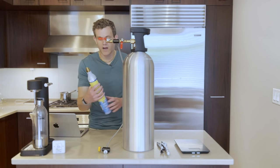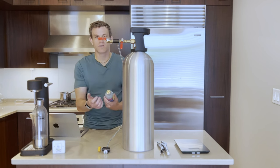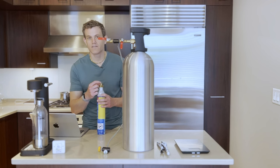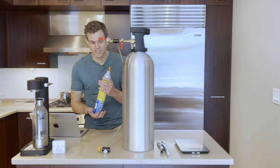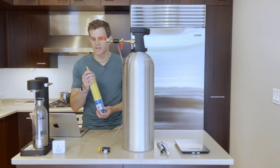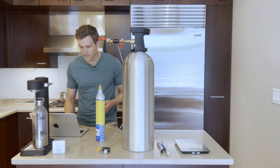A couple of frequently asked questions about refills. First: why freeze the canister? CO2 gas is highly pressurized, and when the canister is cold the pressure inside is much lower, making the transfer process much easier with better filling control. When I've tried filling canisters that weren't frozen I often hit the safety or check valve on the SodaStream ones, so it goes much smoother when the tank is cold. I feel I can fill more of the canister when it's frozen, so I just keep my empties in the freezer. Highly recommend freezing your canisters — no safety issues with it.